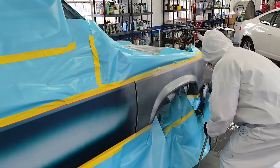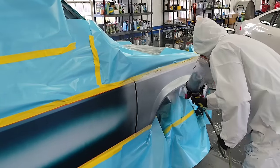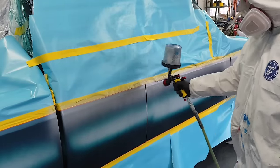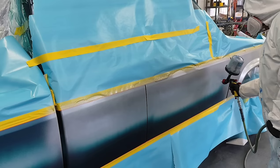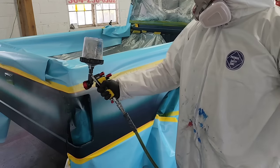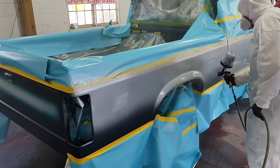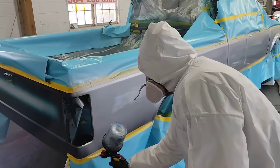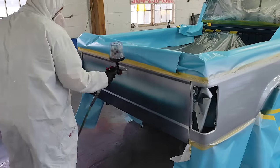Another thing you can do to help remedy the extra texture you might get in the base coat is just using one speed slower on the reducer. So if it's summertime and you're using slow reducer, go ahead and go to speedokote.com, which we are one of the very few suppliers that supply this, and get the extra slow reducer. Or if it's fall time and you're using like a medium, bump it down to a slow. And this will also help remedy that problem. And once again, save money on the base coat, because everybody knows the color is the most expensive part of the job most of the time.